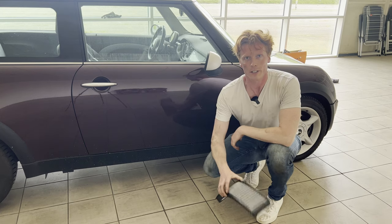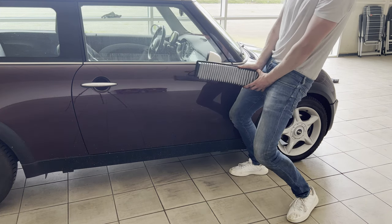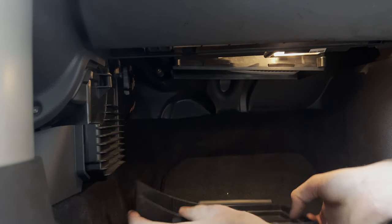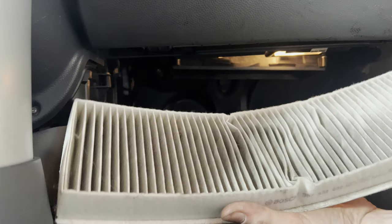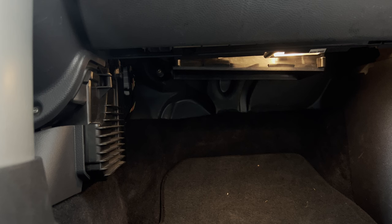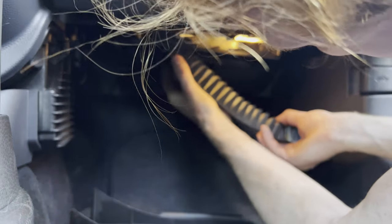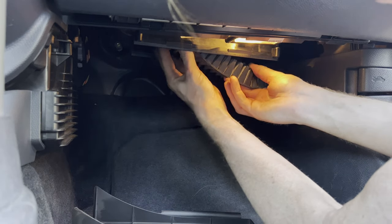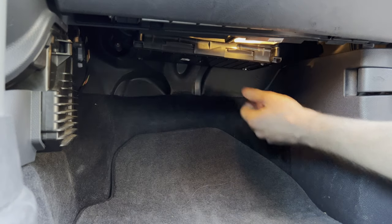And finally, we're gonna replace the cabin air filter. The cabin air filter should be located right over here — inside the car, obviously. We should be able to do this without any tools, so let's figure it out. There's a small tab over here — one — and one over here — two — and we can pop this panel off. There we go. That's the old disgusting cabin air filter removed. Now to insert the new cabin air filter, we need to slide it up in here. There we go. Then we're gonna put this panel back on. And that's the job done.